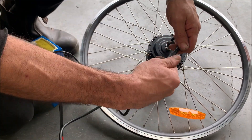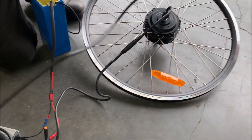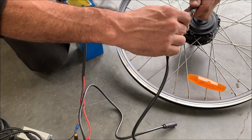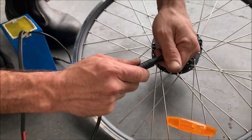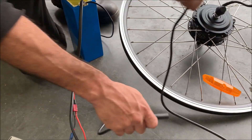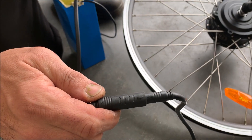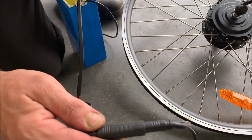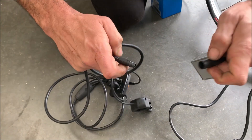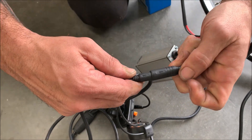So if this doesn't get rid of error 3 with a front wheel, you have your extension cable — that's for the front wheel — so make sure both sides of this cable: you'll have one here, one at the wheel, and then one down at the controller. So make sure if you've got a front or rear wheel both connections are good, and also make sure your 4-in-1 cable is plugged well and truly in as well — just disconnect it and push it back in.